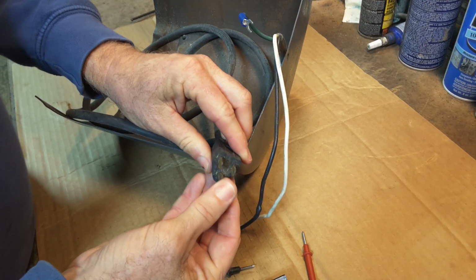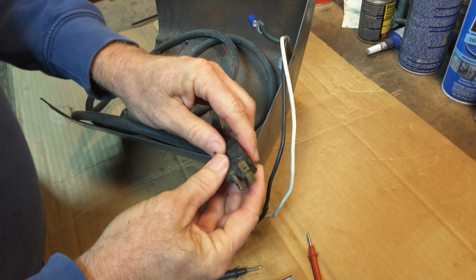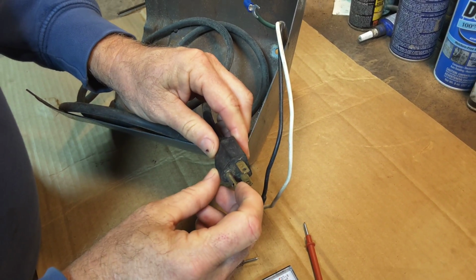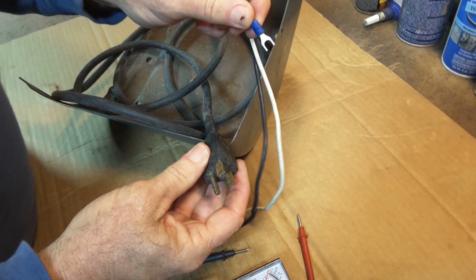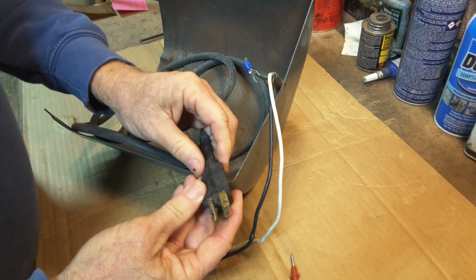I always use a grounded electric cord for safety, because workshops are damp places. You might be standing on concrete, you might even be standing on earth, so you always want your machine grounded, not just with this pin, but make sure your system in the garage is grounded. Make sure the ground wire is attached to your motor, so please be safe.